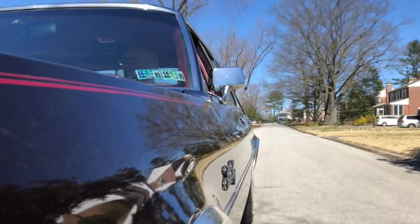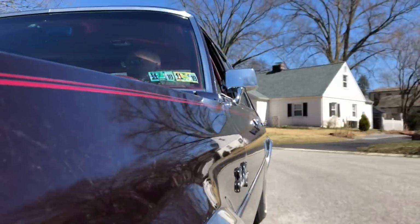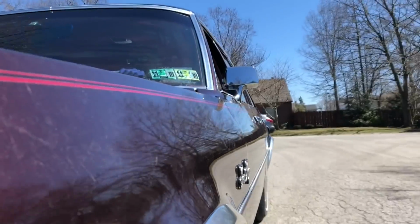And I think that's the number one reason why these cars had such a short lifespan: the electronic system, the complexity of it. There's no OBD port to plug into to diagnose what went wrong or what the issues are. It's trial and error, it's testing, and it's throwing money at parts that you think you might need or don't need. Now, there is an easy fix for it. There are replacement distributors and carburetors that you can put on there. It takes care of the problem, eliminating the lean burn and all the electronic systems that go along with it. But it's $300-400 to do the repair.